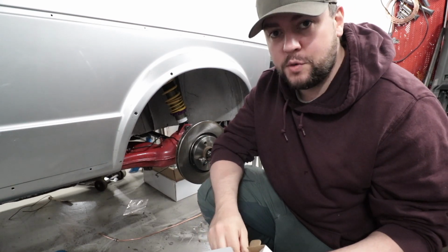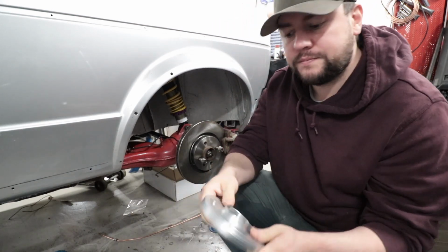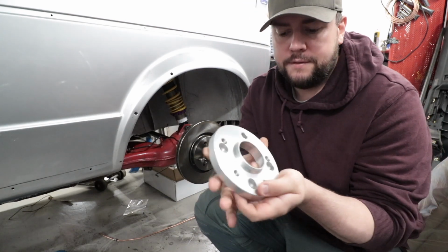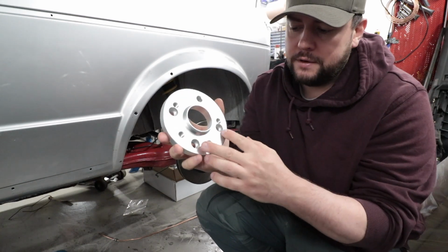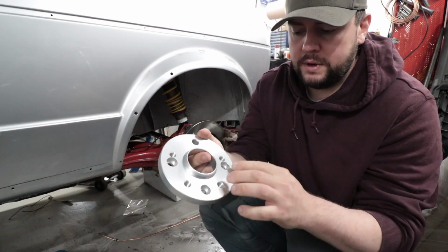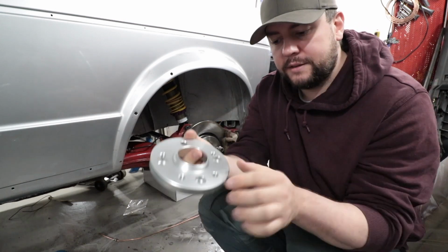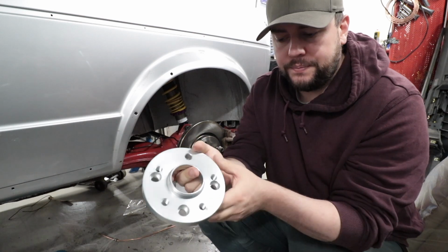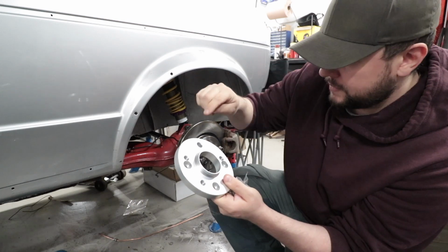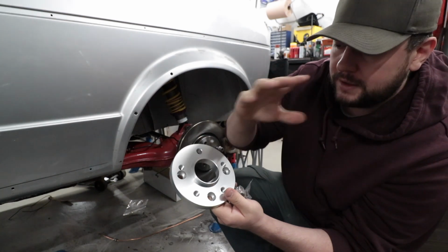This may be pretty obvious, I did not think about it when I bought this. The guys I bought this from in the company said when you use these, on this one you have 3 bolts which only go between this adapter and the brake disc. Only these 3, the biggest ones. And then you have one hole which goes all the way through, and then you have these 4 others which is only between this adapter and your wheel.